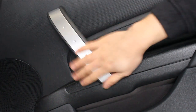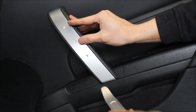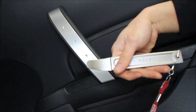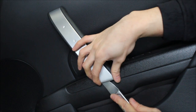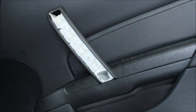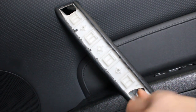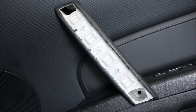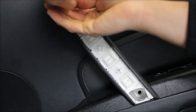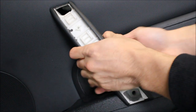Okay, let's get started. We're going to first take off this handle right here — it's an aluminum cover. This is real aluminum, so be very careful. I like to use a panel removal tool that has a lot of surface area. You could use a flat head screwdriver, but you have such little surface area you have more of a chance of creating little dents in it. With that cover off, you'll expose the fasteners, and the door handle is just two 10mm bolts. Once you've loosened your fasteners, they'll just pull right off.